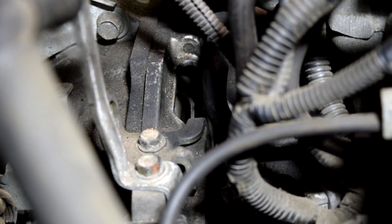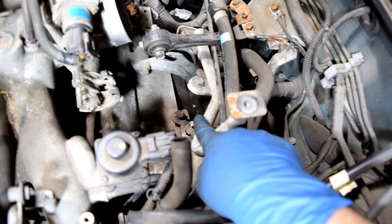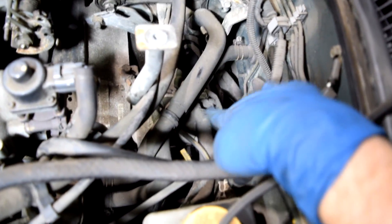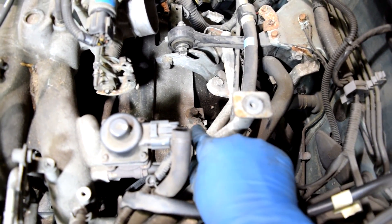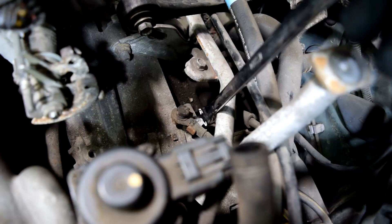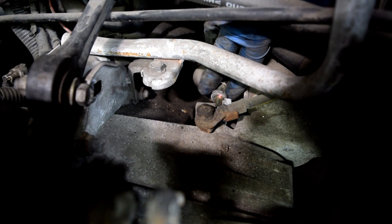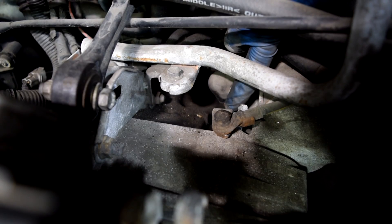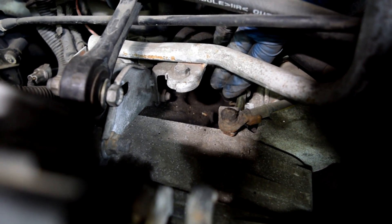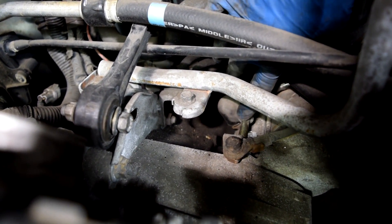There's the 4th and last one. Next we're going to get started on removing all the bell housing bolts, and we're going to first start by this one right here that attaches our starter motor and assembly. It also has this grounding cable here. Make sure you make a note of all these grounding cables you remove because it's very important to put them back right where you take them off. These are going to be 14mm bolts. There's going to be a couple of washers on this, and the cable that goes to the starter is going to block it — it's going to keep us from removing it completely, but it's okay. We'll let it rest here until we get the other bolts on the lower side of the starter out, then we get to push the starter out of the way and get this bolt out.